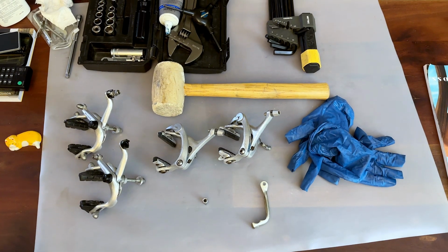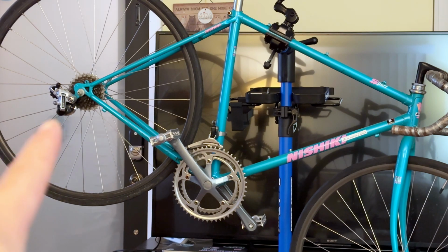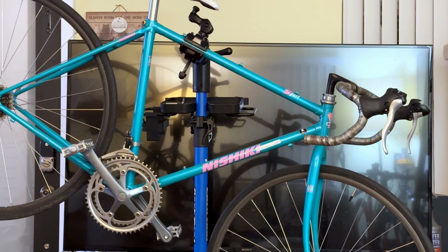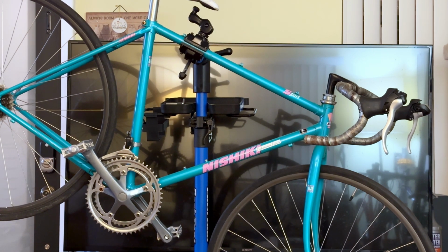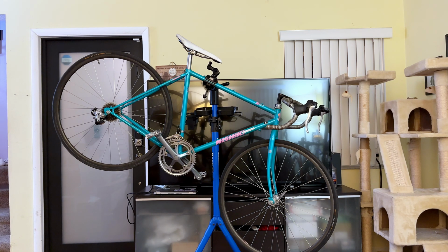With the restoration, I also decided to put the old derailleur back on there because it looks period correct and it works fantastic. So I'm not changing the rear derailleur either. The only thing I'm changing now is the shifters, which definitely is a major factor for me. Once I get the shifters changed, I have to set up the triple to convert it into a double for the front crank, and then put on the new tapes and new cables. I think it should still be a really nice vintage chromoly bike that's got a very special paint on it. But at this stage, since I did not expect this, I want to tell you that some components I originally decided to replace from the Specialized, I am not replacing.